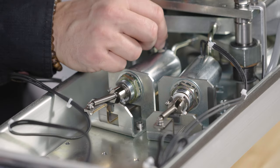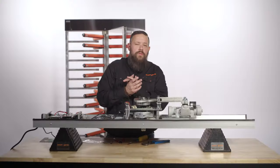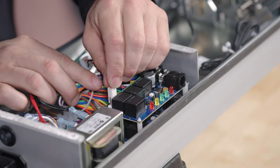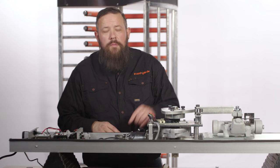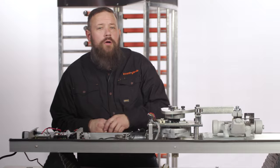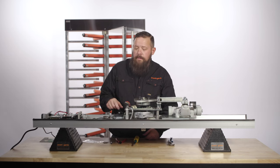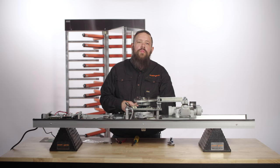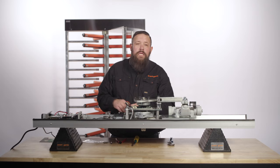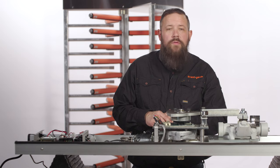Also make note that your wire is facing up and not facing down, because it would interfere with the linkage. The jumper on the main control board will have to be changed from fail lock to fail safe. The locking pawl spring will also have to be changed on the corresponding lock line. If your unit does not have the small spring, that part number again is 100-131, which can be ordered directly from our website linked below.